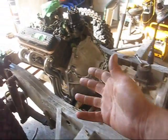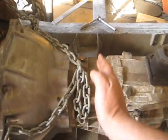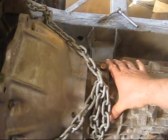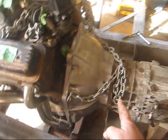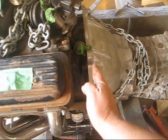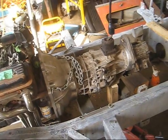I haven't mentioned the bulkhead yet. With engine conversions one of the great concerns is clearance to the bulkhead. One neat thing about this conversion is the transmission is so long — plus the adapter — the stock Land Rover bell housing would have been about here, and that's where it would have had clearance to the bulkhead. Now this is actually very small and compact at the location of the front of the bulkhead. I'm not the least bit concerned we're going to have trouble there. It may even be possible to drastically enlarge the foot well on the driver's side to get more leg room, though I don't really feel like messing with it.